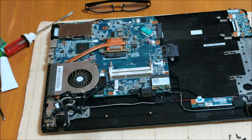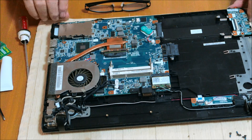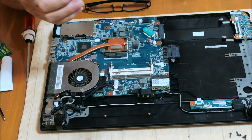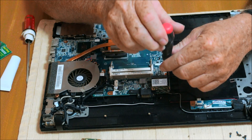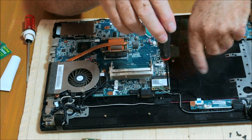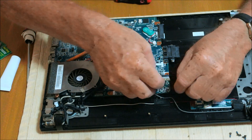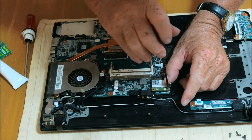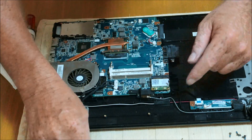Okay, this is where we're at today. First off, we've got this little Wi-Fi card here — this is used for your Bluetooth and your Wi-Fi. My troubleshooting, when I ran and checked my system devices, everything I checked showed that it wasn't working. Here's your Wi-Fi card right here — we're going to set it aside. Here's the new one, and I'm going to plug it in, slide it down, and tighten it down. We've just installed the Wi-Fi card.